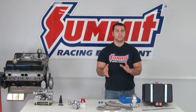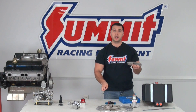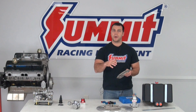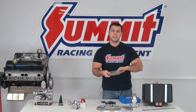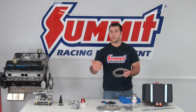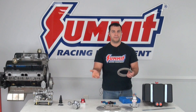I mentioned hoses — we've talked a lot about making your own braided hose lines, and there are different types of fittings that go on the end of braided hose lines. I'll include a link to that video here, both for Teflon braided hose lines as well as standard braided hose lines. You can create your own custom hoses to run from your fuel cell up to your filters, to your fuel pump, and up to your engine. You do want to make sure those connections are secure so you're not leaking any fuel.